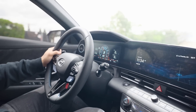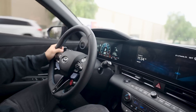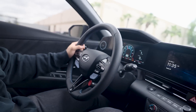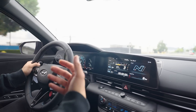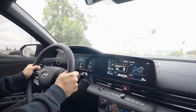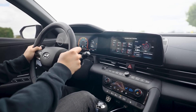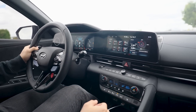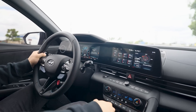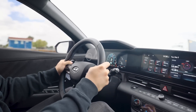We're on the road now with the new Boomba engine mount. Install was super simple. I'm going to go ahead to the same location and do a first gear launch control test from inside and outside to see if we get some dramatic changes. Off the bat I do feel a bit more vibration through the seat — probably because it's a little stiffer now. All right, here we go — first gear launch control. Oh yeah, a lot less! Wow, that thing's a lot better!